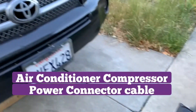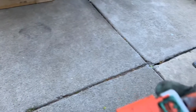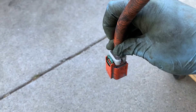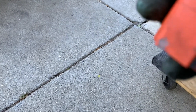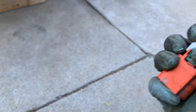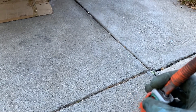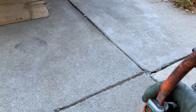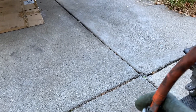I pulled out the inverter here, and one of the items that I really had a hard time dealing with was this connector to the AC compressor. This actually goes into the AC compressor like this, and in order to remove this plug, this green tab, you have to lift it up before you're able to push down on this orange tab. So lift the green tab, stick like a flat screwdriver or a pick in there, pull it up this way, and then you'll be able to access the orange tab — push on the orange tab and pull up on the harness.